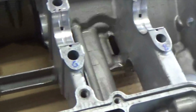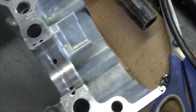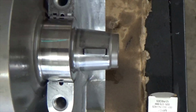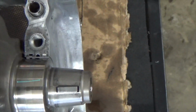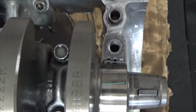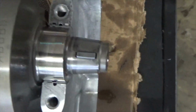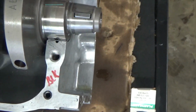And let's get back over here to the bottom half. So you see my bottom half? See my new bearings? I've put all new bearings in that bottom half. I've already done this motor, but I'm doing this so people would have an understanding. You've got to measure these bearings. You can do it by calipers, which I do both ways. I can see where the journals have run out. Measure the journals to see if they're out of service or they're good enough to continue to use.